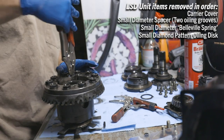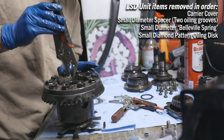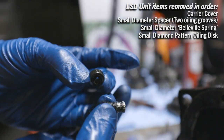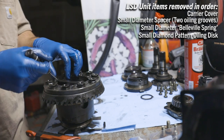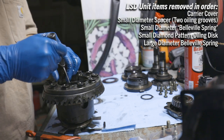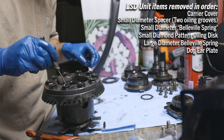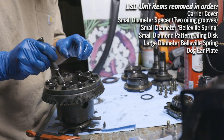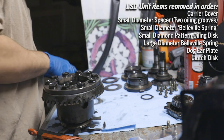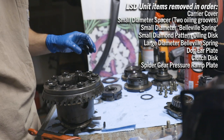I think we got it. A little bit of extra PB, slow turning. Broke off, right there. So next up we got the spacer, then we got another spacer, then we got a clutch, a big hunk of metal, and then we got spider gears.